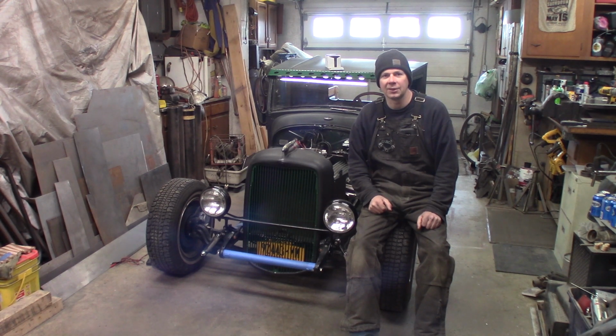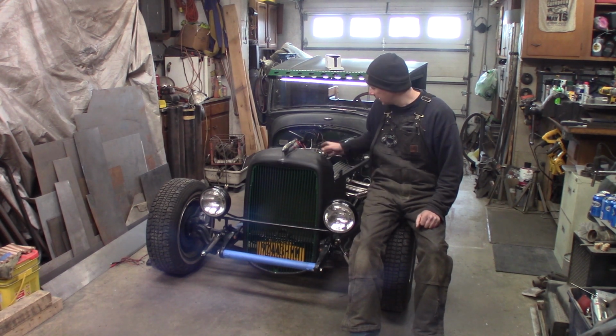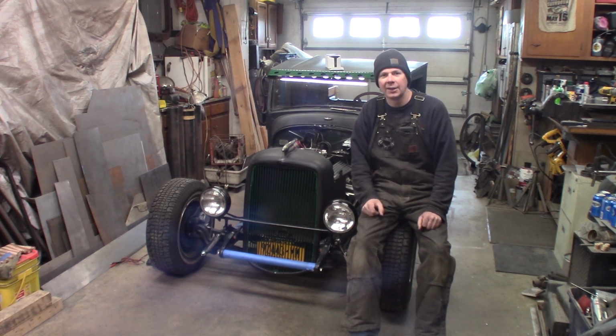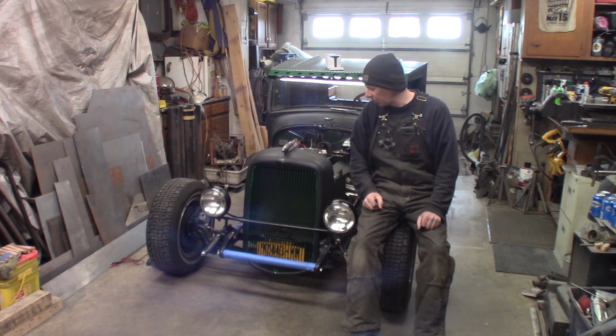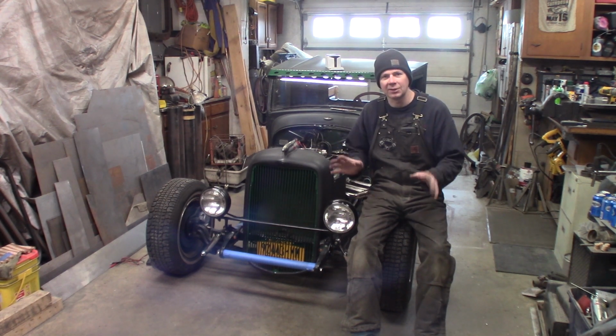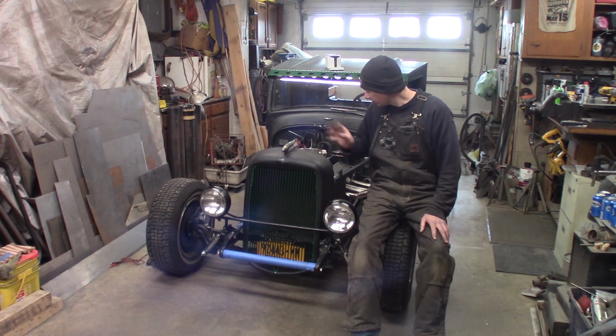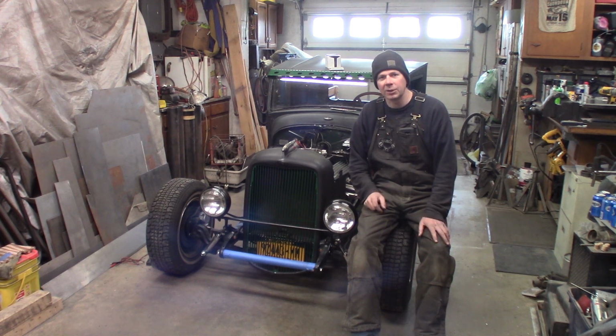It drives straight. It's got good power. I need to tune it. It was pinging a little bit. That's why I got out and I turned the distributor back and retarded the timing before it quit to make it not ping. I like to set the timing by ear till it sounds good when it's running, and then dial it in with the light at the end. So I know that the gas tank works now. That doesn't leak, so everything's good.